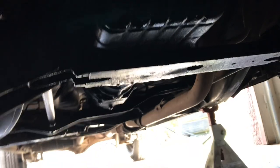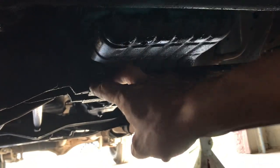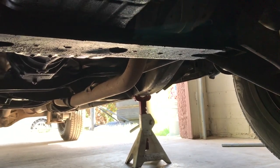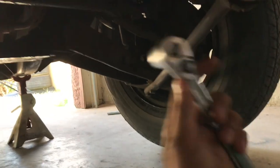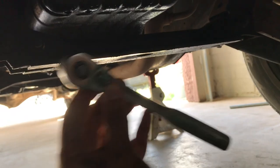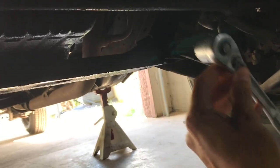What I'm doing right now is taking off the two bolts from this side of the cross brace for the engine that connects to the A-arms. There are two bolts here and two bolts over there. I grabbed a 19 mil socket and basically put it on those bolts.